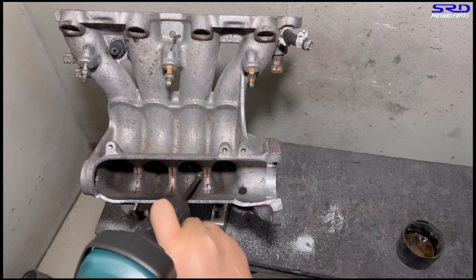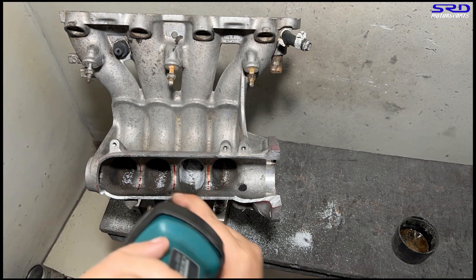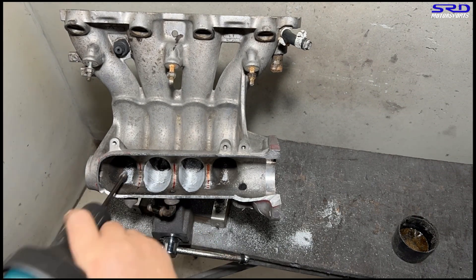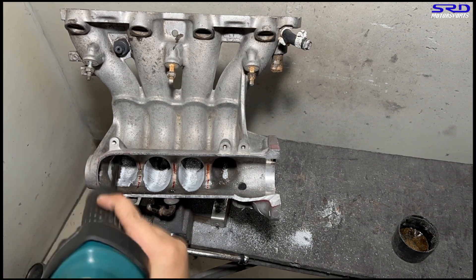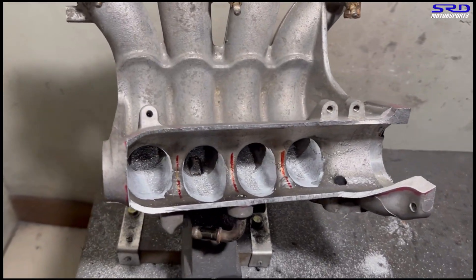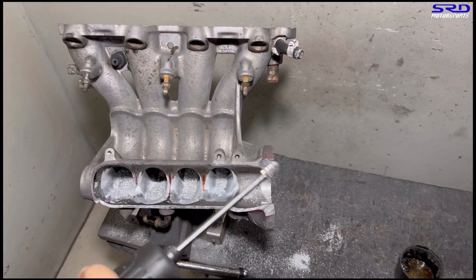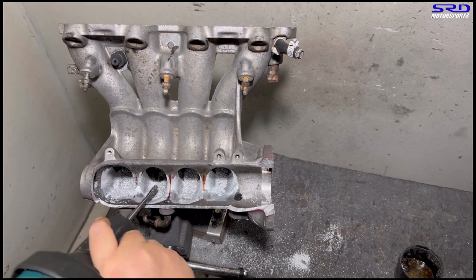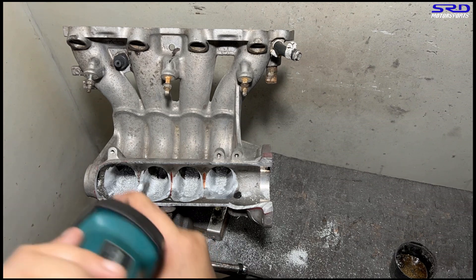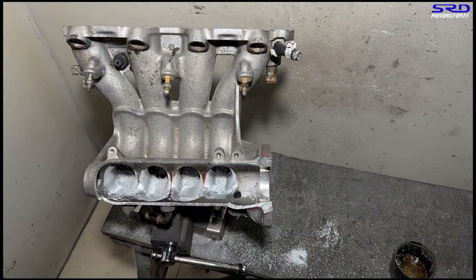After chopping the manifold, we start with the carbide first to get the shape going. We time-lapsed this. On the divider we drew a red marker just for reference - I just wanted to make sure, usually I don't do this but when you need to be more certain, it doesn't hurt. Here's the initial shaping that has started - you can see we're opening up the entry. Now we go with the cylindrical carbide cutter so I can do the contours smoothly without bumps or lumps. We slowly get the shape to how we desire it - a more consistent gradual opening for the entry that mimics a velocity stack.